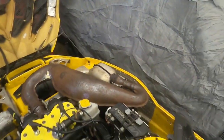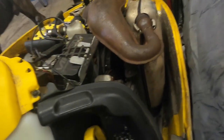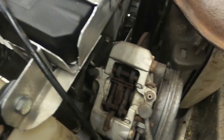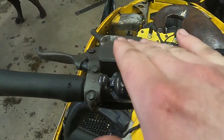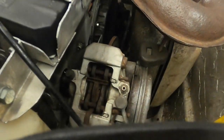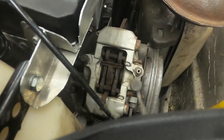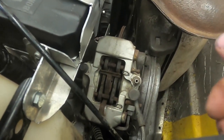This is something that people probably really don't think about. Right down in here, this is your brake caliper and your brake rotor. What happens is this master cylinder gets all gunked up with crap over the years and doesn't let that brake caliper fully release. And then as that happens, you start running down the trail — if you don't notice it, you'll actually catch fire. This one would have done it had I not cleaned the master cylinder all out.